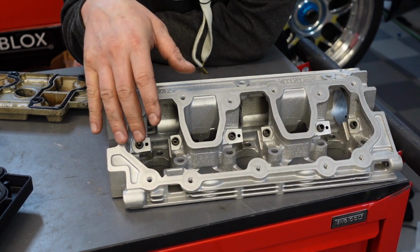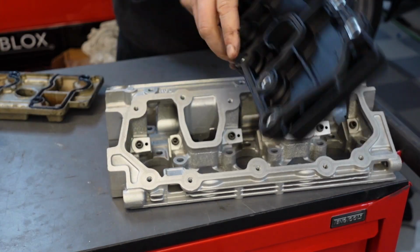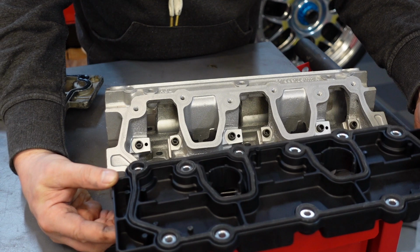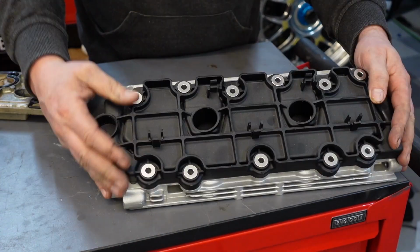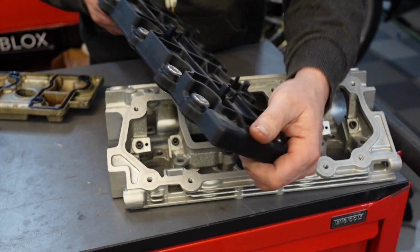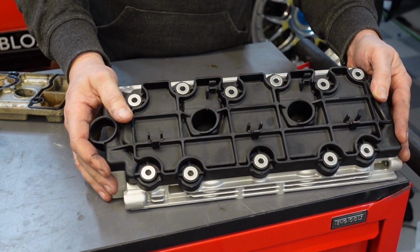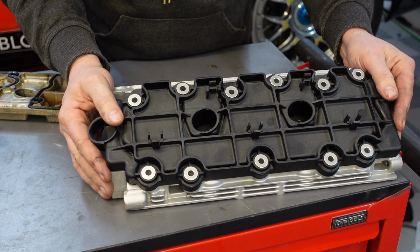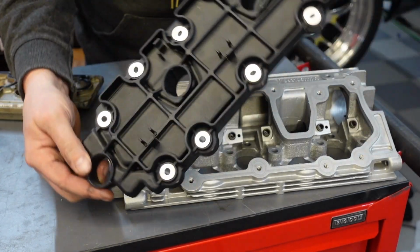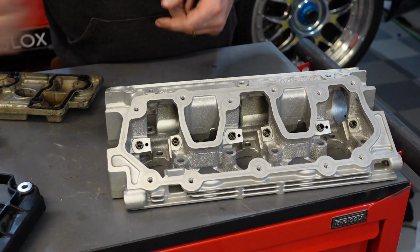And as you can see, the area here looks completely different. We still have a cover. The covers are now made out of plastic, right? And this plastic does not warp. It is lighter, and it sits still with a seal just like before. But this cover now keeps tight because it doesn't warp like the magnesium did. So this is the first improvement, both on weight, I would say looks, and also in terms of how it seals. Then we look at the rocker arms.